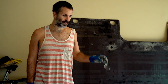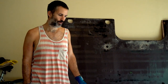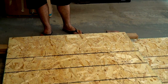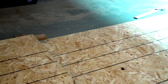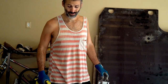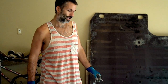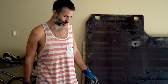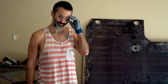We're doing the final part of the subfloor before we put on the click-and-snap. This is the plywood or OSB board and we're going to cut it out — we've traced it using templates from our van. We're going to use an orbital jigsaw for that. This is probably one of the tools we use the most during the van build. You use it for a lot of things with plywood — it's a handy tool because you can shave around the corners. Safety first always.